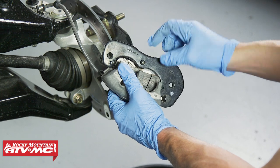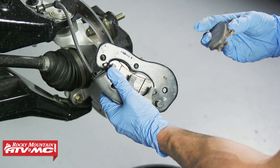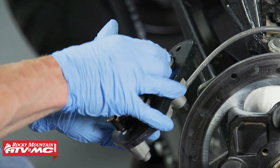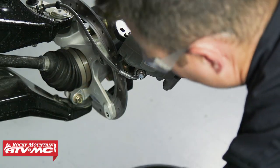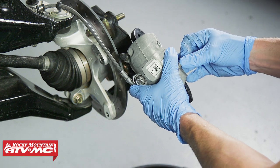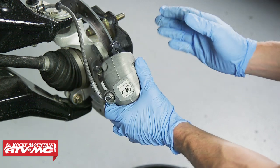From here, this is where you're going to install your new brake pads. You want to make sure that anti-rattle spring is still in place and in good condition. We can start with the inboard pad — set that into place. We're actually going to reuse the pads we removed just to show the process since this machine only has a few miles on it. On the outboard pad, you're going to hook it onto the pin and set it down into place. When you install the pins, it's going to be easier to start on the upper end. Press down on the pads a little bit and press down on that spring. Make sure the pin goes through both of the pads. If you have a hard time getting that other pin in, you can again press on the pads.